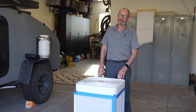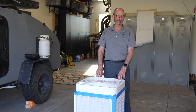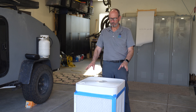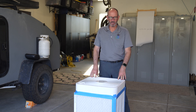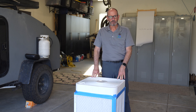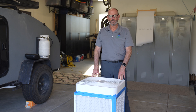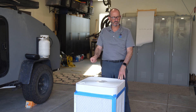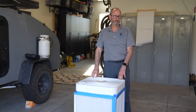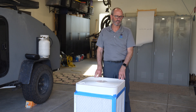The second downside is that it's a box fan. If you've ever tried to sleep with one of these in the window, you know they're noisy. This one on high speed — so you're delivering as much air as you possibly can — is about 64 to 65 decibels. If you run it down to cut the noise, it drops to about 57, but that's still quite a bit of noise in the room.